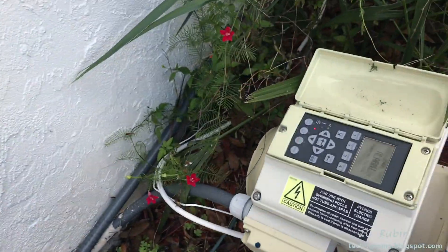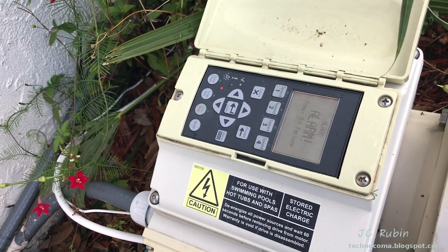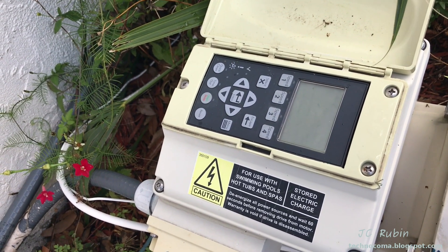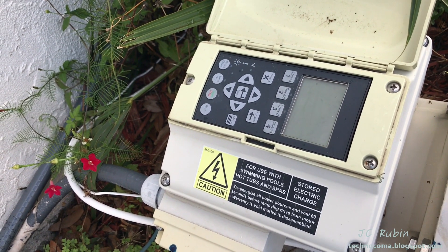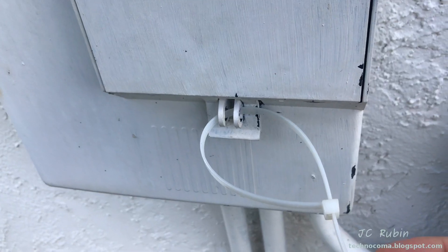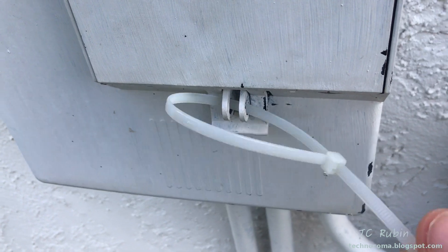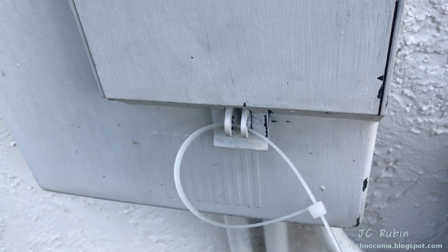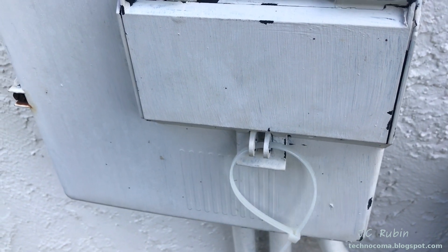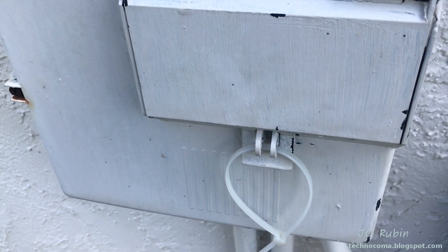It's still on right now. You can see it's still on. I've cut that power and there you go — now it's off. So now it's dead. Now I can take out the power, cut the PVC pipes, which is the easiest way to do it, and pull this pump out. And just so I don't have a stupid senile moment, I'm red-tagging this bad boy. There's no way I'm accidentally going in here and turning on these breakers once I disconnect this 240 volts. I really don't need that type of aggravation.